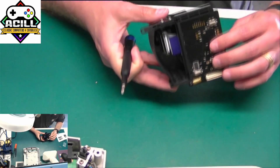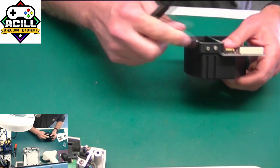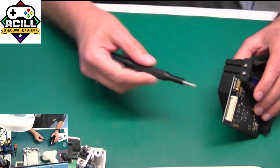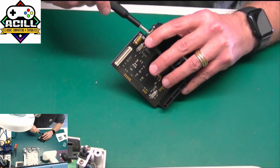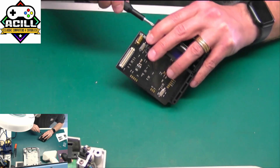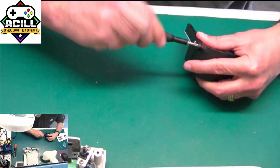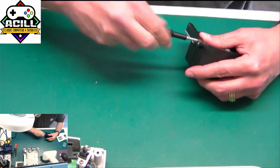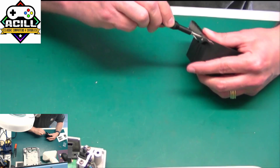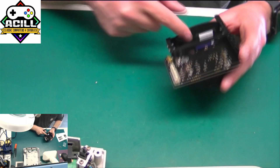Next, we're going to take the GDEMU and put it on the bracket. There's a little button that sits right underneath for resetting. Just like before, we're going to do the four screws — the bracket fits around two screws on each side. We'll go ahead and screw these in slowly to give the threads a chance to seat. You don't want to go too tight or you'll strip the plastic. It's pretty easy to do, and at the bottom everything fits in and keeps it tucked out of the way.